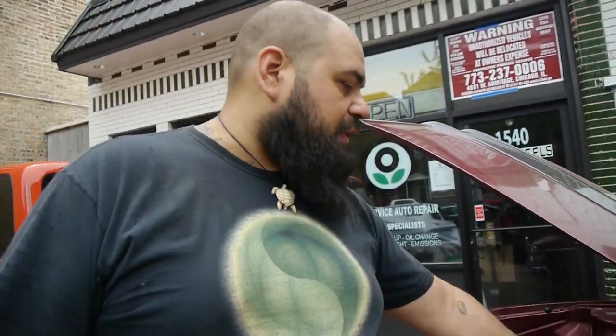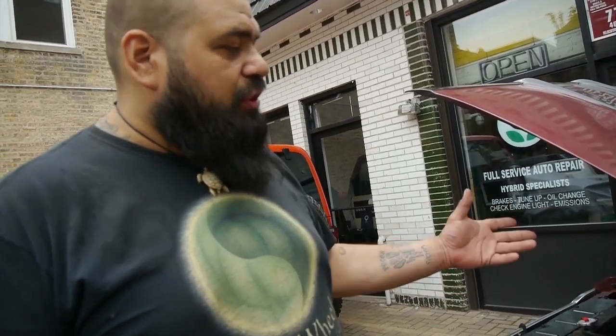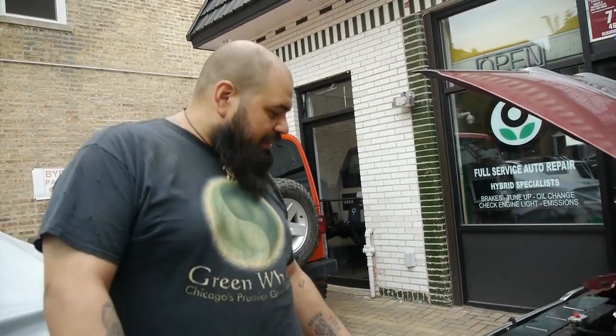He did have all drums. Richard was having a hard time stopping. Even though it's still manual brakes, it's not power brakes, he does stop, I want to say 50%, 60%, much, much better. So the discs do make a big difference in braking. We do hear a little chatter here and there from the brakes, but we're still waiting for them to settle in. Other than that, we were working on some other things. Now we're just going to tune up the car, man, and get old Roy back to his owner.